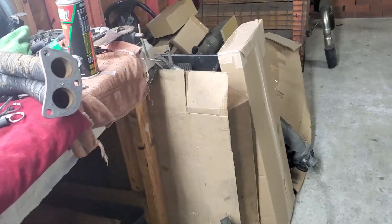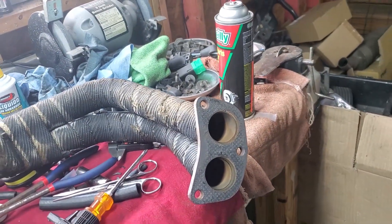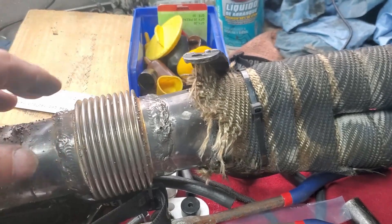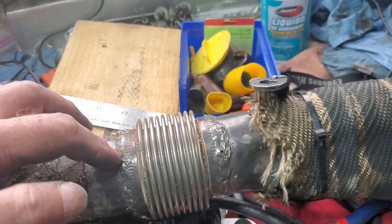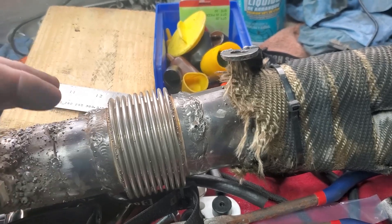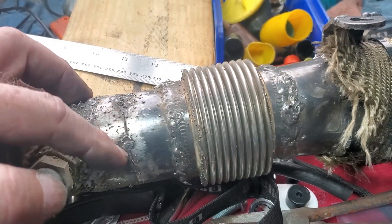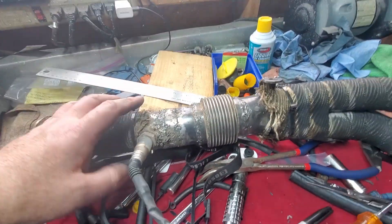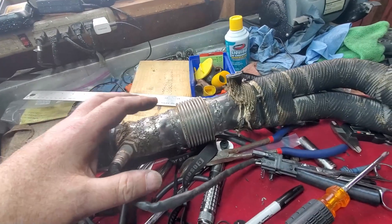The holdup to a fire-up video is the header — the welds are nasty. A guy in the neighborhood welded these for me at no charge. I've tacked the new flex section on just now underneath the car, barely up off the ground with a welding hood on. I'll take it back to him to finish the welds. I keep wondering if this Harbor Freight welder isn't the issue — I get the concept of welding, but this one only has minimum/maximum voltage settings.